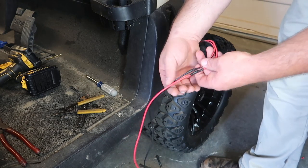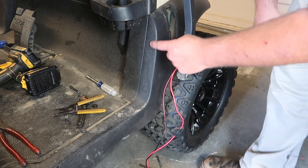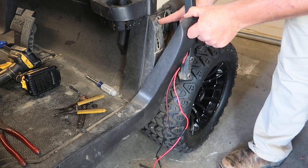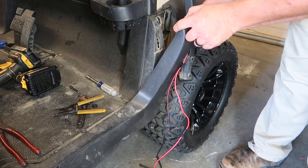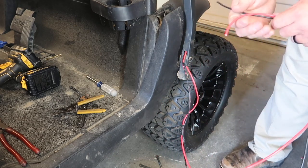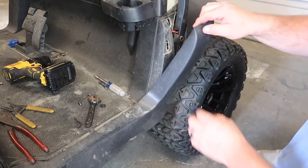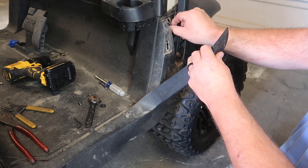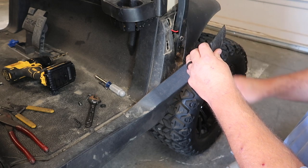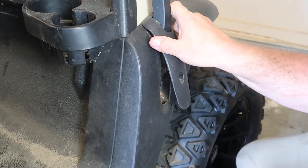Off camera, I went ahead and extended these wires using solder and iron, then covered them with black tape. Next, you need to run them into the dash. This side piece on this Club Car just unsnaps. There's a hole right here — when you put this bar back into place, this wire is going to sit here. We run it behind the dash through that hole. Now we have one bolt in, the wire is going in the back, and then you just need to mount this one and put it back together.